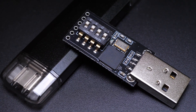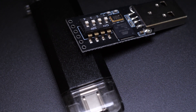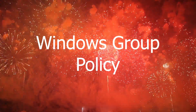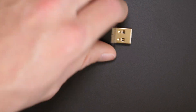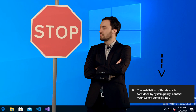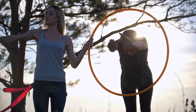So back to explaining how to mitigate my own devices. The last, but probably the best way of preventing bad USB attacks and all HID attacks in general, is via Windows Group Policy. I realise that doesn't sound all too exciting. However, we can actually configure Windows to prevent it from installing any new USB devices. Plug in an unknown device and it'll just say no. Now, this won't affect any devices your computer is already familiar with, so it's not really going to get in your way.